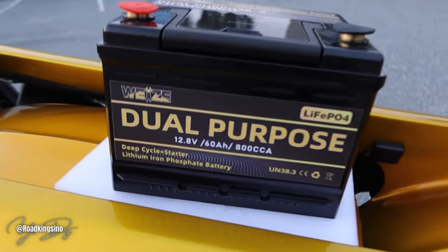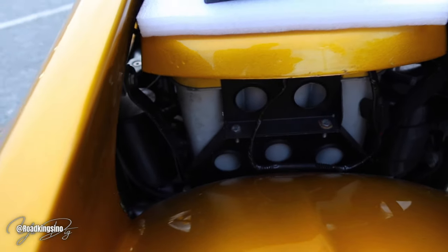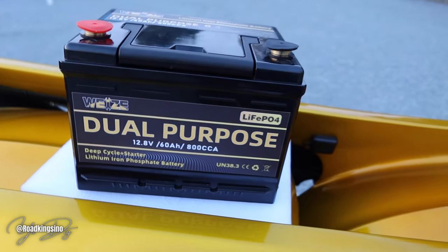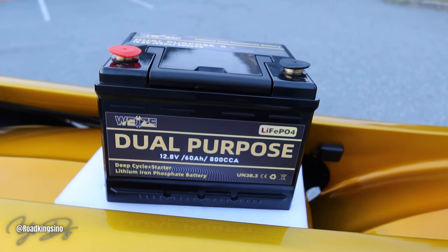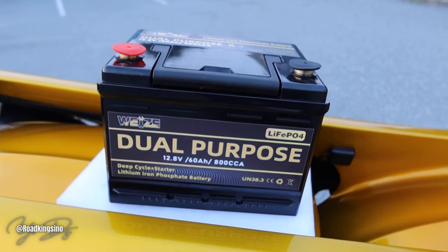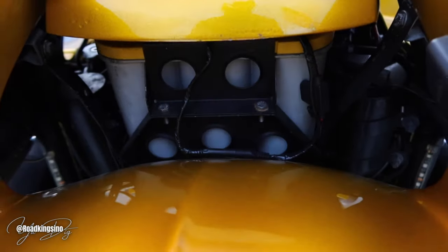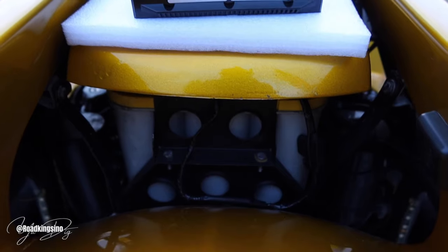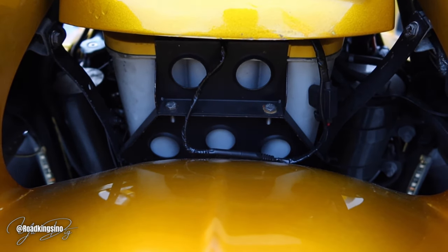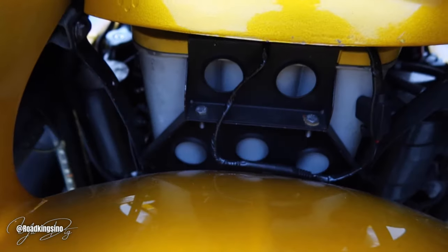I'm not going to put it on a scale, I'm just going to take it for what it's worth. Even if it's 14 pounds, that's still hella light compared to a battery that's pretty much 44 pounds. Let's talk measurements real quick. Length of this battery is 9.06 inches. Width is 6.89 and height is 7.88. So this battery should fit right in this compartment with no issues. By it being so light, I might not even have to use the top that I have for the battery tray. I might just use some straps, try to keep it clean and nice looking.